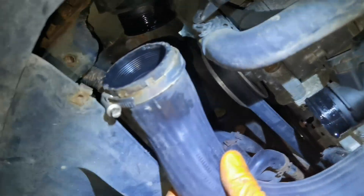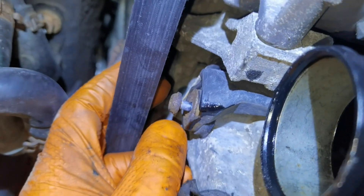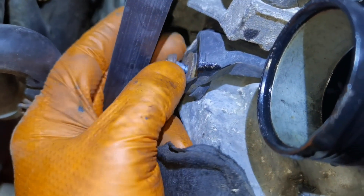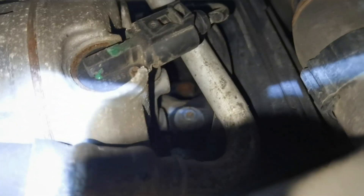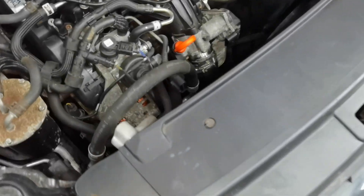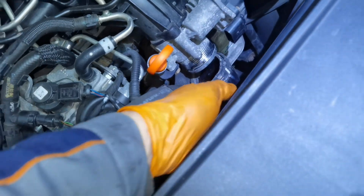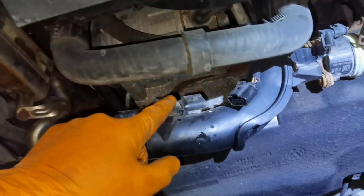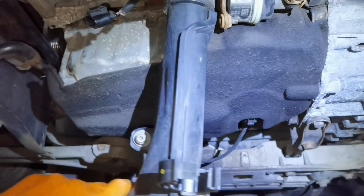You'll have to remove it and put it down. After you finish removing the hoses and screws securing it to the car, you can pull the tubing out from the engine and you'll have more space to remove the auxiliary water pump. As you can see the bracket on the left side is now loose. I'll go underneath the AC compressor to remove the other screw and then pull the entire tubing out. I also disconnected the hose attached to the throttle body and pushed it down. You'll also have to disconnect the connector from the sensor on the plastic pipe, then pull it down and it will come out very easily.